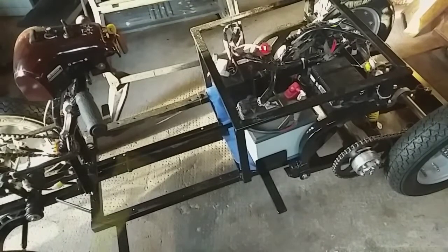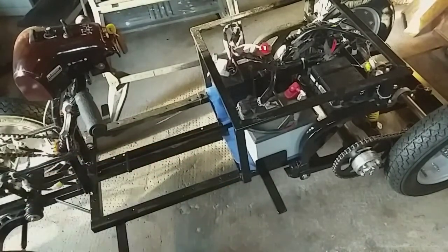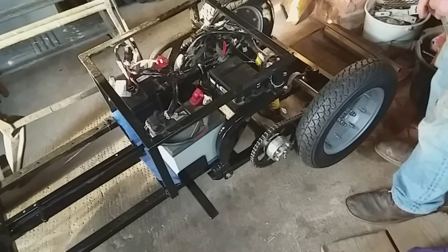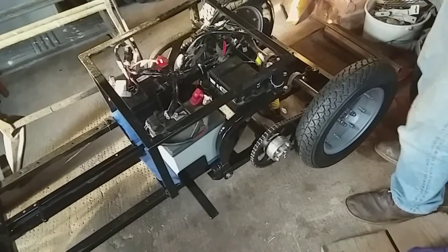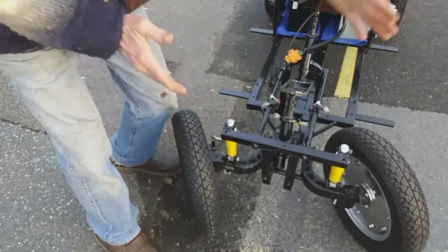On the back end there, I have drilled out the 8mm bolts because they're not very strong, and I've put 65mm long stainless steel 10mm bolts in there - drilled it out and fastened them all up. So that's made the back end stronger. Also where I've put this extra added length on here, it's given it a bit more leverage. So because these are designed to carry 35 stone, the suspension will work a bit better if you're not over the top heavy. I've also put some spacers under there so the steering can't go so far, because it would be easier to roll it.